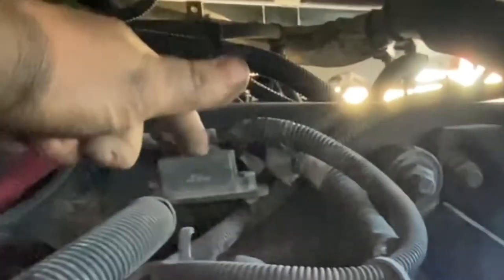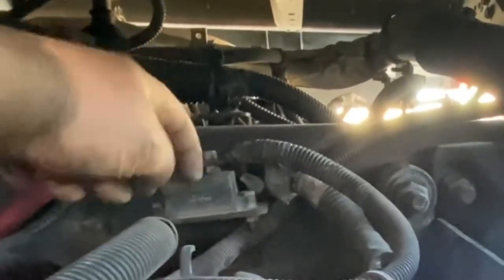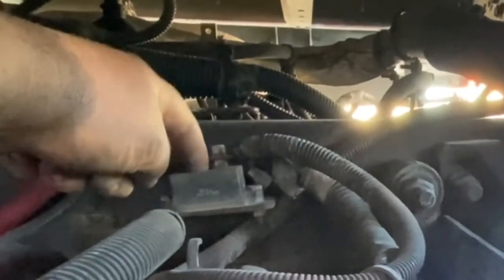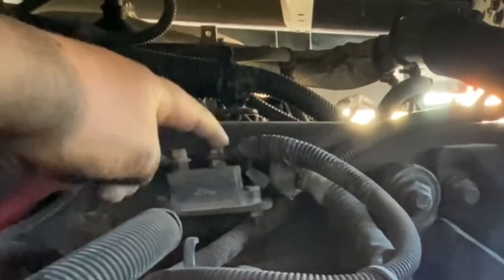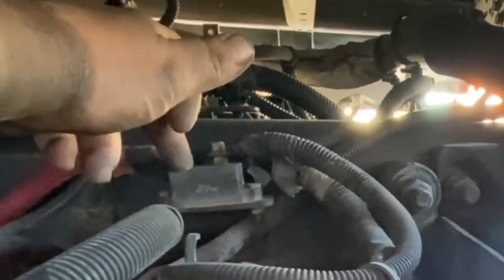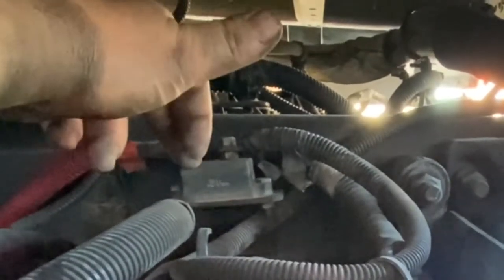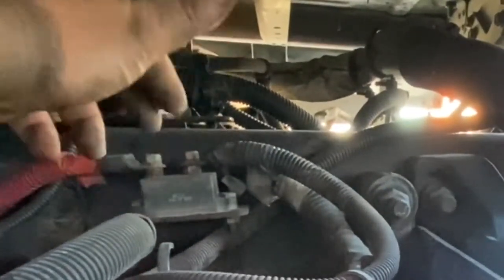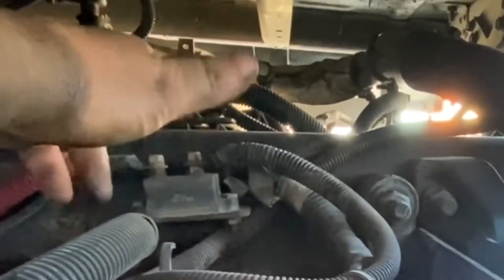There's your breaker. This one I don't think can be reset. So say you don't have power here but you do have power at the cord, and this breaker is bad — you can bypass it temporarily if you're stuck somewhere, just jump it over to get power and get the liftgate down or up, just to get it moved.